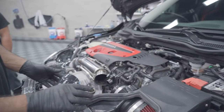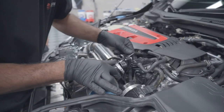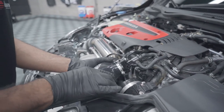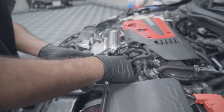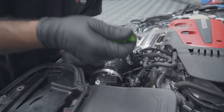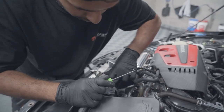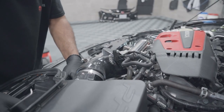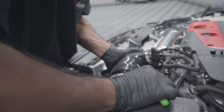With everything still moving, you want to slide it in — no hairspray because it's nice and easy this time. Vacuum tube that they have here first, then the big one — slide it onto the inlet. For the part that fights you a little, use the 90-degree pick, grab the pipe from the edge, pull it in with your finger as much as you can, and just push on it with your pick. Find the right spot for the air box and they'll marry together.